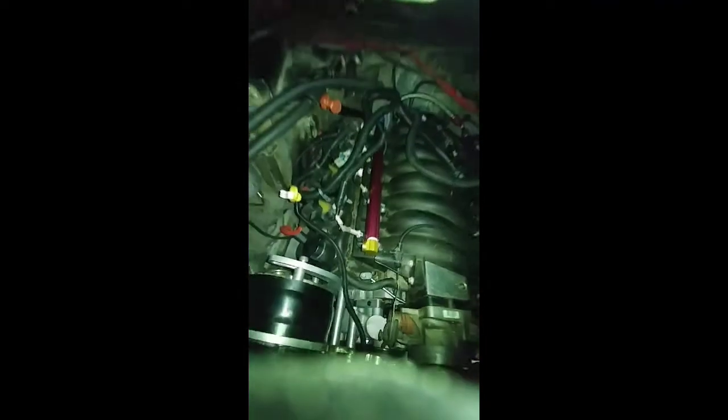And since this was an 89, it was a factory fuel injected car, so it already has the fuel injection lines and the pump and the tank. So we're going to have to upgrade it to an LS pump, drop the tank, and put the LS pump in there. Like I said, we'll just run the hard lines up, put the Corvette fuel filter regulator up there, and make the hard line into a soft line so it can plug up over here to the fuel rail. That's it, and then we'll be running and testing it and make sure it does what it's supposed to do.